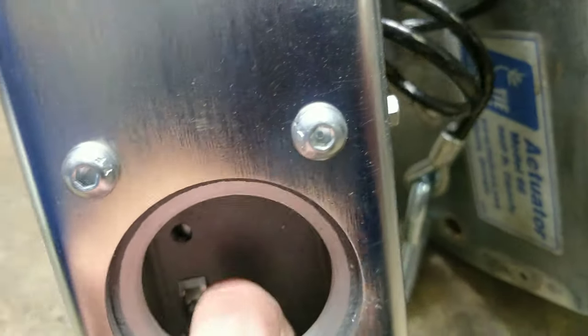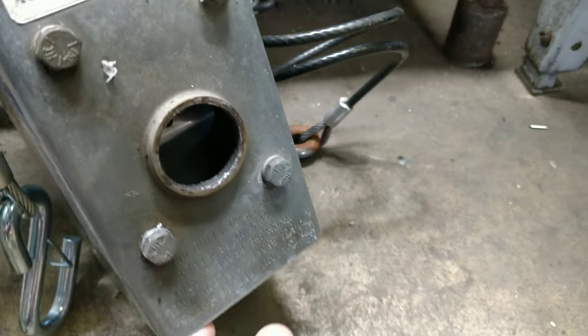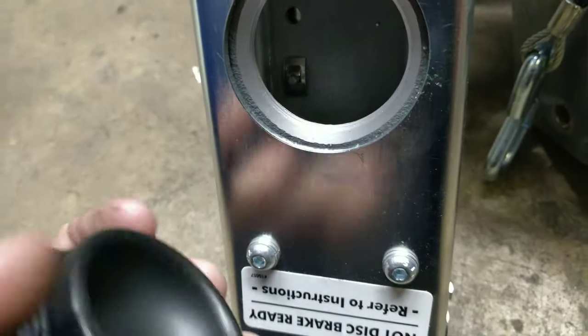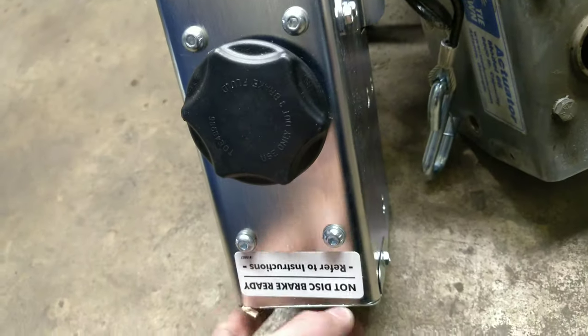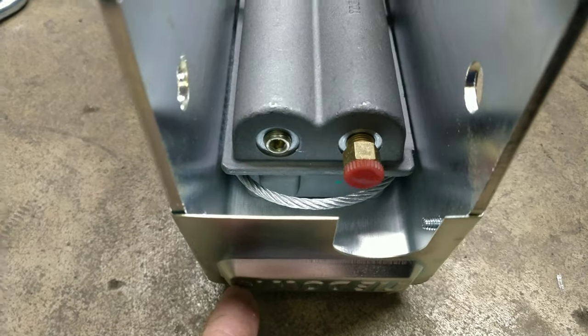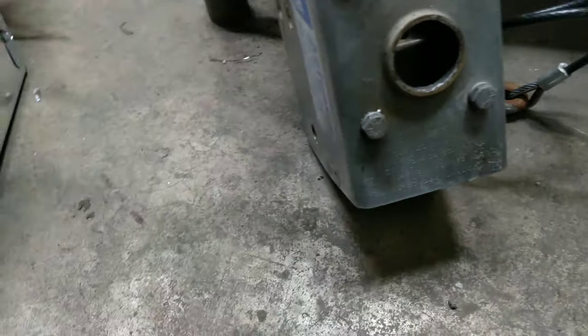It was revised. The master cylinder now has its own top versus using the trailer bracket. And this one has a seal that goes around underneath here to seal it to the top. Where this one has this special cap with an O-ring, and this whole metal tube doesn't seal it. See if maybe we can flip it over and show. Yeah, see, it doesn't use this top piece of the flange to seal it, where this one,